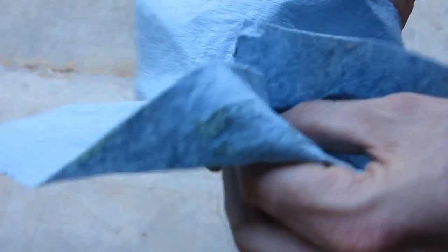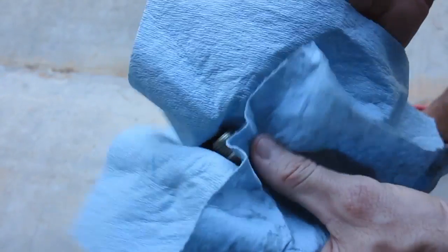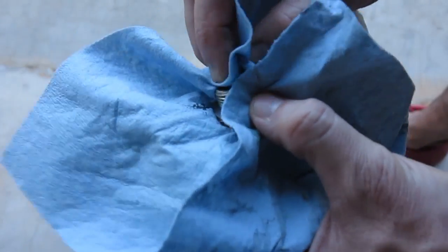It is. Unfortunately, when we go to clean off the transmission drain plug, the news is not so amusing. No, that's not good. What's wrong with it? There's a big chunk on this magnet, which means there's a big chunk missing somewhere in the transmission. Oh, that's not good. That's what I said. You need something to stick down in there.